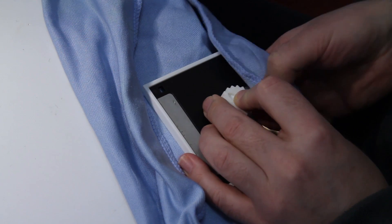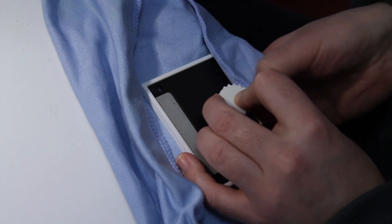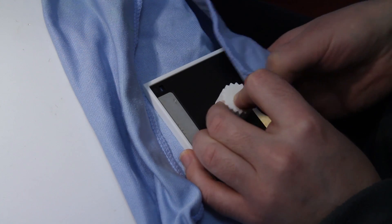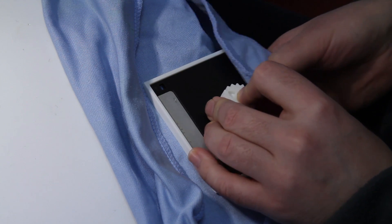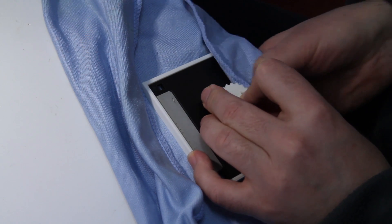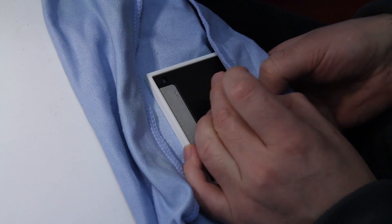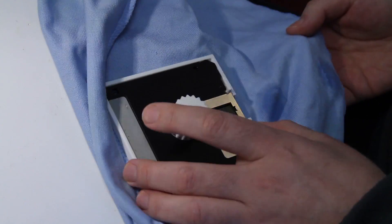With the arrow printed on top, you can see if you've made a full revolution. I usually do 3 revolutions to completely clean the disk. I've cleaned more than 300 disks this way, and the disks that I didn't clean or forgot to clean were immediately damaged by the disk head. All the disks that I cleaned didn't get damaged.